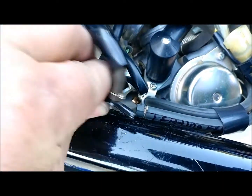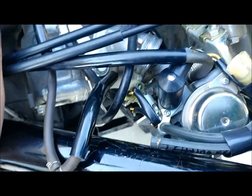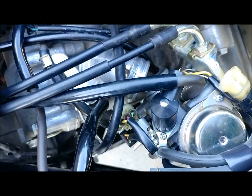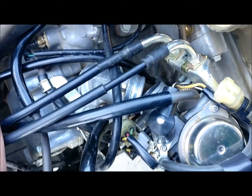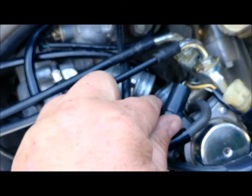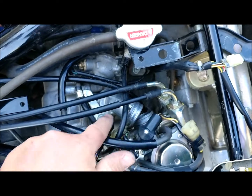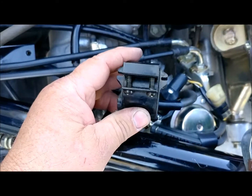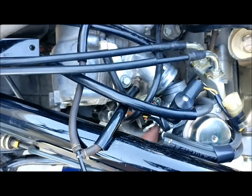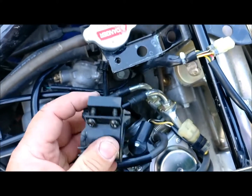I know I don't have the wiring hooked up yet - I'll get that here in a moment. And then I've got this vacuum port here that needs to hook up to that. So anyways it looks like everything that I explained is pretty correct, and I hope you enjoy the video because I couldn't find any videos online that detailed it like this. I will continue to hook this up. Right now I have to get my intake boot in here. The reason I loosened this intake was to have enough room to pull the carburetor up. Now that I've put it back down in there I've got my intake on, but I've got to work on getting this boot down in there. I'll pull the carburetor back a little bit more - that probably should have gone on first, but that's the life of a mechanic when you're working on unfamiliar stuff.